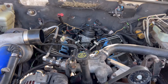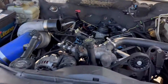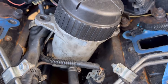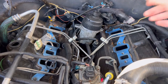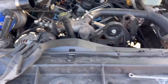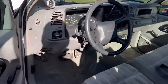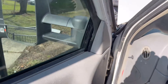After some fiddling around, the upper and lower intakes are out. Here's my workbench for the day since the garage is full, and as you can see there's a lake of diesel fuel in here that goes all the way up to the front of the valley. I think I'll go ahead and prime the lift pump and see if maybe it's one of my fuel bowl fittings - front or rear - and check my return side. But I'm really thinking it's an injector line because of how much fluid is in there. These trucks are known for fuel leaks in the valley, especially if the fuel bowl goes bad.